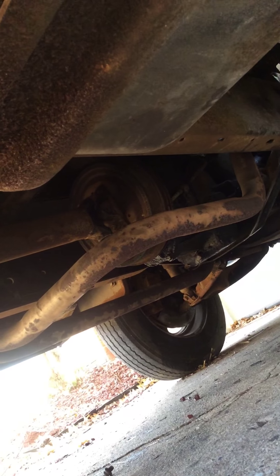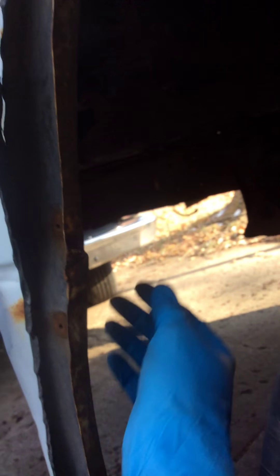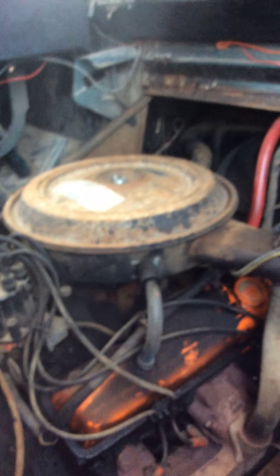I've got a new clutch I had put in — that was one of the first things I had to do. There are a lot of holes in the floor board, but the frame is solid. I do have some rust right here in the floor pan — part of when they hit this and put that drill in there and messed the rivets up. It's all steel, and steel is easy to weld. I forgot to rebuild the kit for the carburetor. It's a Rochester — an aluminum body carb.